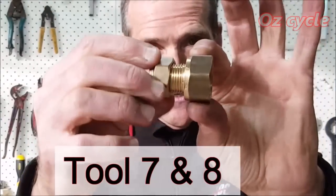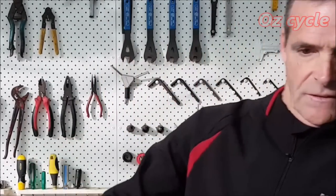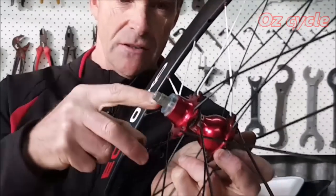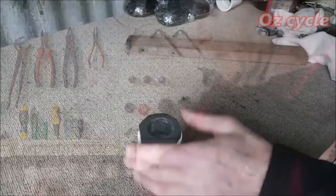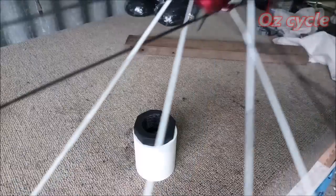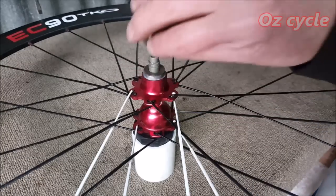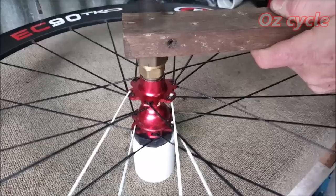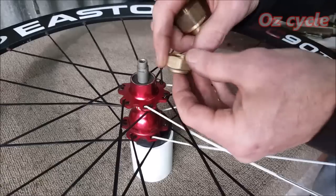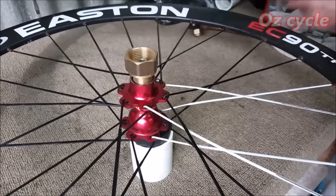Now you need these two pieces — one just screws onto the other. You've got your washer, your bearing ready to go in, a special washer just the right size, and this thing goes on so it's centered. The poly is the supporting block again, drive side down. Put your brass bit on top, piece of wood, and tap, tap, tap. If this gets in the way, you can just use the brass piece straight like that and tap a little bit more.